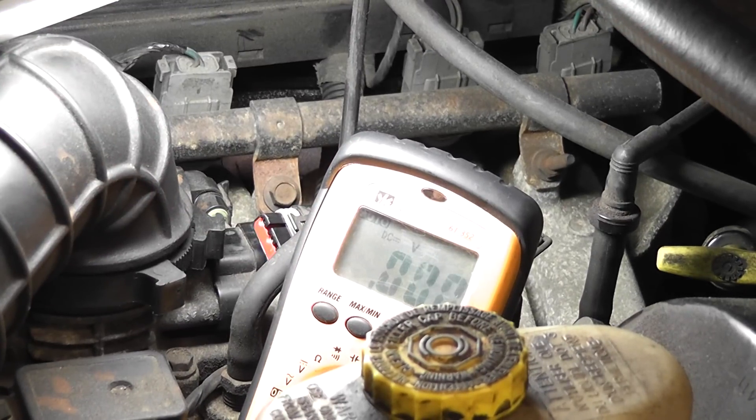So what do we know? No 5-volt reference — it's not there. This computer is not alive; it's not talking to us. Our 5-volt reference circuit isn't there, so we're looking for direction. We're going to pull up a wiring diagram and figure out what all shares this 5-volt reference circuit. We're also going to check what fuses the computer uses and needs for this system to operate. That's why I can't talk to it with my scan tool, and it might also be why my fuel pump is running all the time.